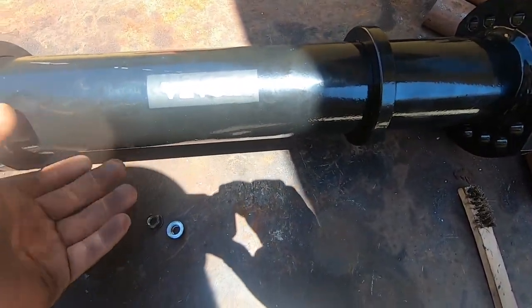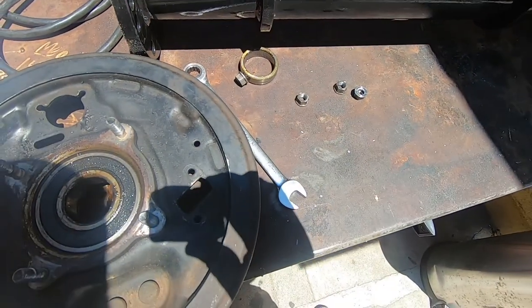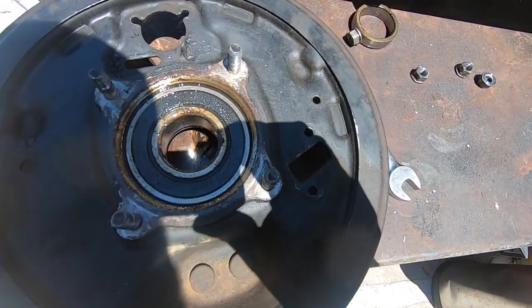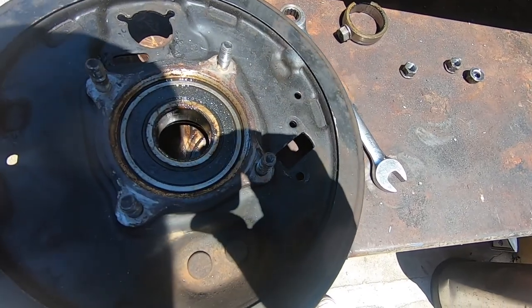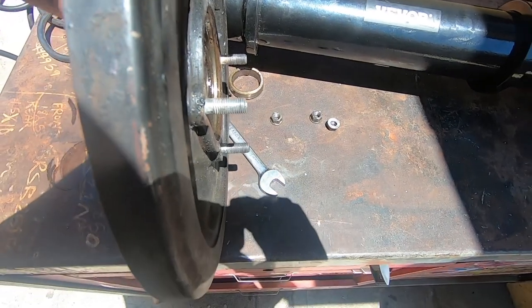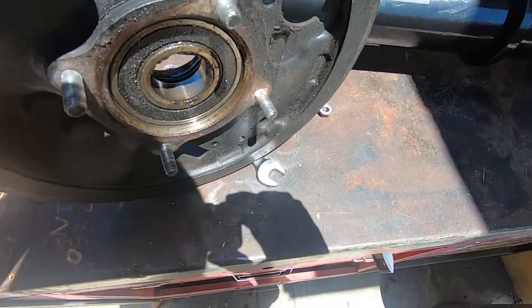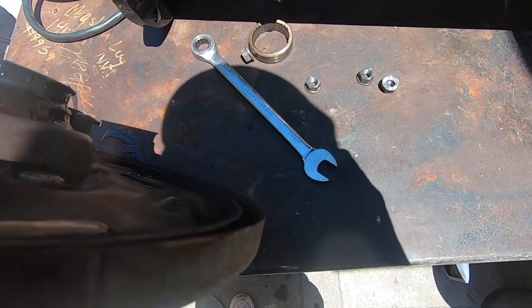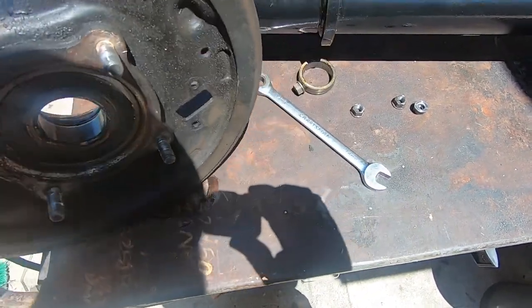This is the actual tool we picked up — it fits a couple of different Toyota axles. By the way, yesterday when we got back with the press, we tried doing it with just the fittings that come with the press and we kind of bent the axle out of shape a little bit. So we put it backwards and tried to bend it back into shape and kind of got the dent out. We still have to check it and hopefully we don't have to replace this.